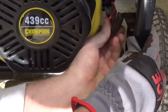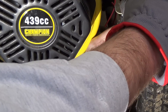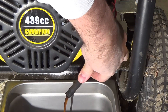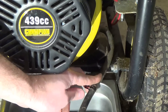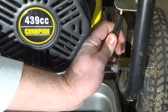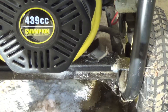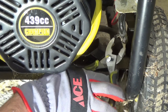We undo the dipstick too — that will help. And that is some pretty thin oil there, and it's draining. Pretty thin, probably because it's mixed with fuel. Alright, so we got all the oil drained, and now I'm just going to reconnect that breather tube slash drain hose and tighten the clamp back up on that.